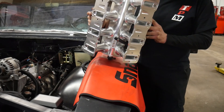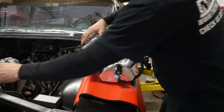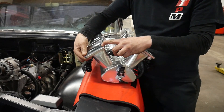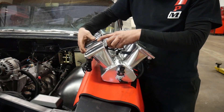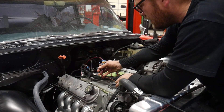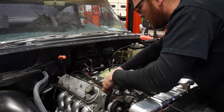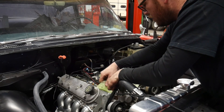We do have to put O-rings in the bottom — it doesn't take a standard gasket anymore. I'm not sure where these O-rings are sourced from, whether they're from another production vehicle. Hopefully it's something that's easy to get if you ever tear one or want to replace them during a rebuild. Make sure there's nothing in here that can fall into the heads once I pull the tape off — no dirt, debris, or rocks.